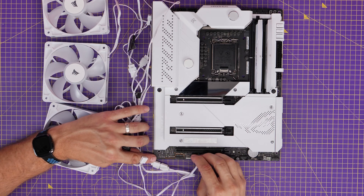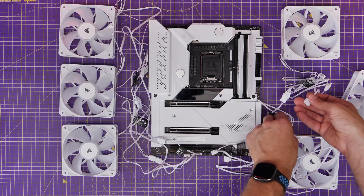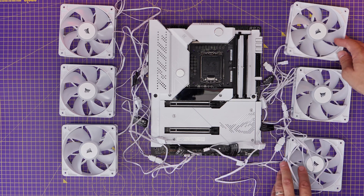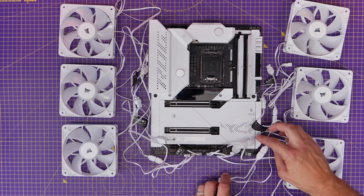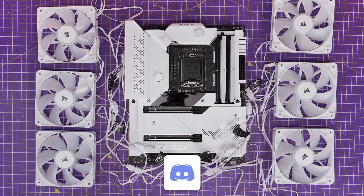This is also good news if you only have a couple of 5-volt RGB headers on your motherboard, because daisy chaining means you can easily plug in multiple fans. With two groups of three — six fans total — each group is separately daisy chained, giving you just four cables: two fan powers and two RGB connections to the motherboard. I wouldn't recommend daisy chaining more than three fans for fan power to a single header, as there probably won't be enough power, but you can safely chain the RGB connections from more fans together.